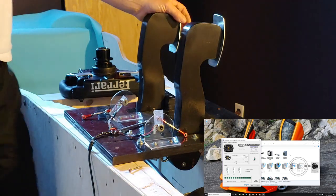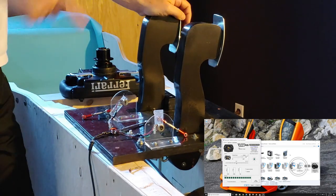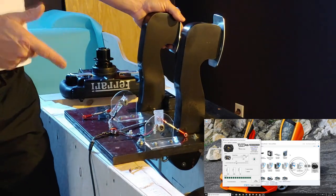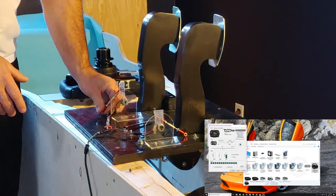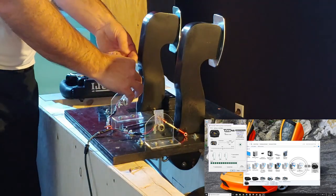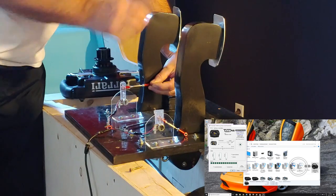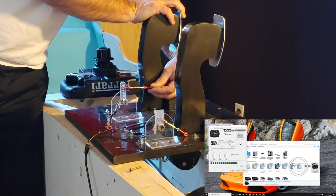I am connected to the PC in the devices and printers section. I turn the switch to PS3 - when you're connecting the Thrustmaster T300S to the PC you need to switch it to PS3, not PS4. It will not recognize the wheelbase if you leave it on PS4. It's working. Let's put that on the neutral position and see what it does when I move the pedal.